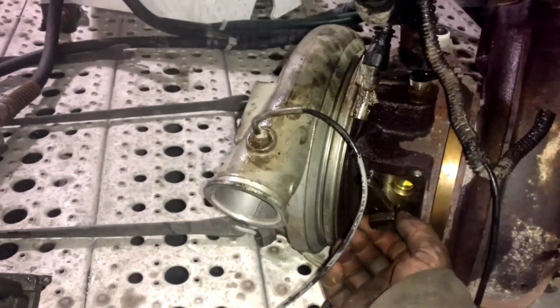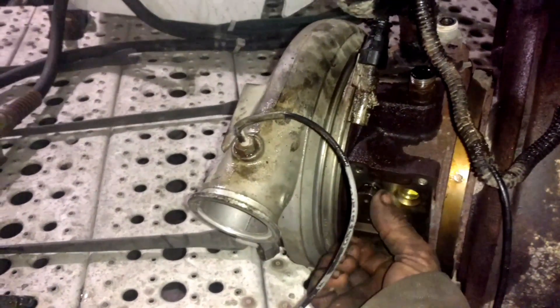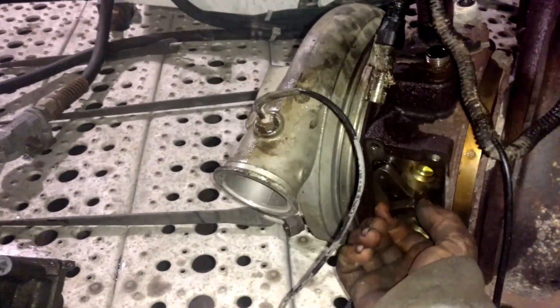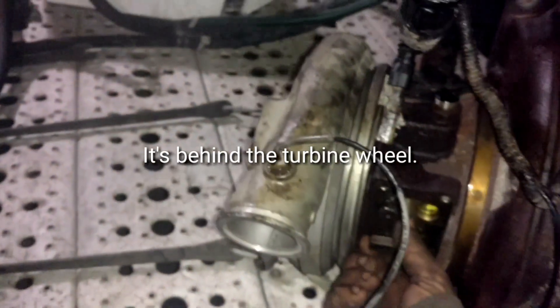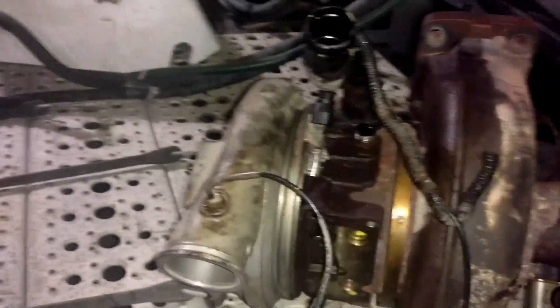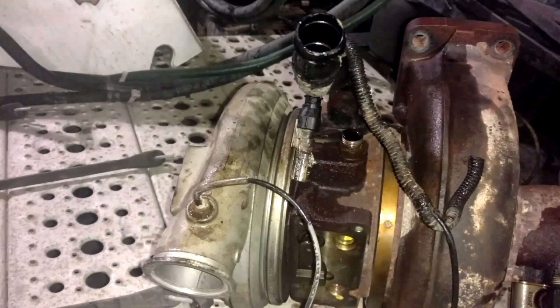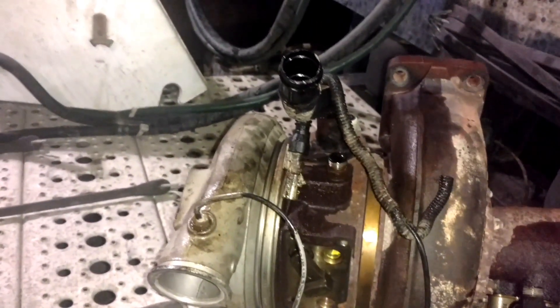But what caused the motor to fail? Just like on an ISX, this cone moves back and forth. When I first started to move it, it was really hard — I had to tap it with a hammer to free it up. You can hear how noisy it is. There's a cone down inside here. I've cleaned these up and gotten away with it for a while, but usually when these start going on truck turbos, they're history. Time to change the turbo.